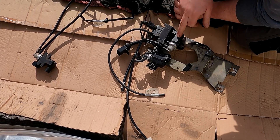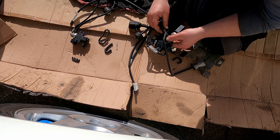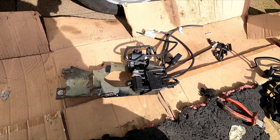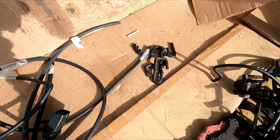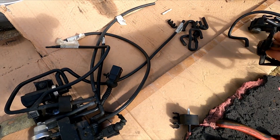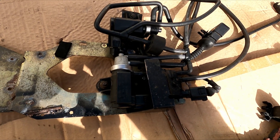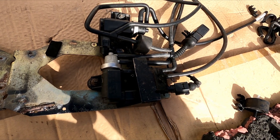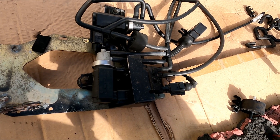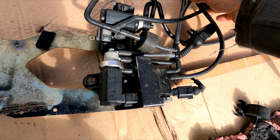Here's version one — let's see if it actually works. I've got quite a few little bends and things left over which I don't really want to cut. Since I've had the second donor set, I don't want to use too many. It's just slightly more simplified compared to the original, which was all in a big row — that's why it needed so many swing-back bends. Essentially simplified, but all the pipes are there: the three control lines, the one for the servo, and the one for the accumulator.